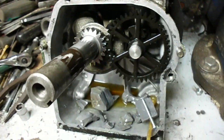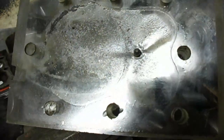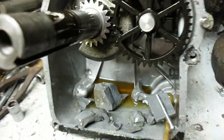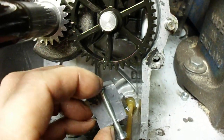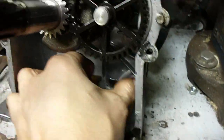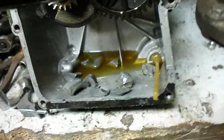Here's the scene of destruction I encountered when I took the crankcase cover off. Just to show you the cylinder head — oil all over it. I'm not pulling your leg here, this thing actually ran, just my camera decided not to record it. I changed the design on this one — I didn't use a nut; instead I drilled and tapped the JB Weld and Loctited it in place. Man, I really massacred this rod — this is worse than the first time. Part of the cap — she just grenaded.